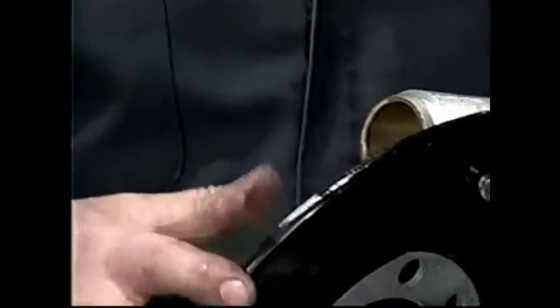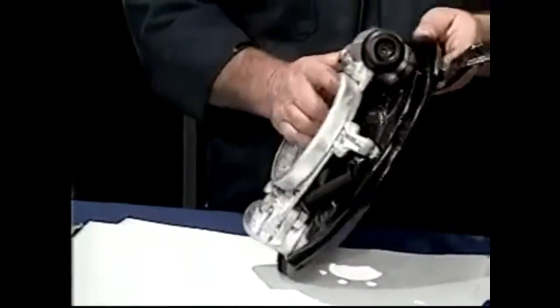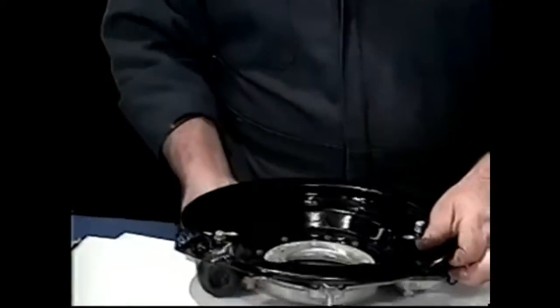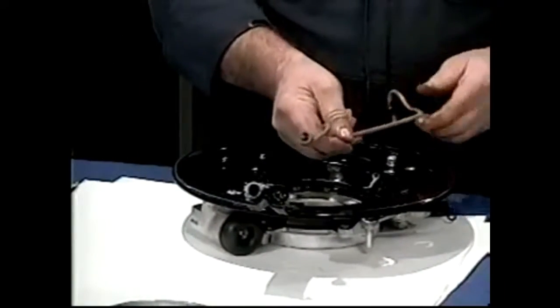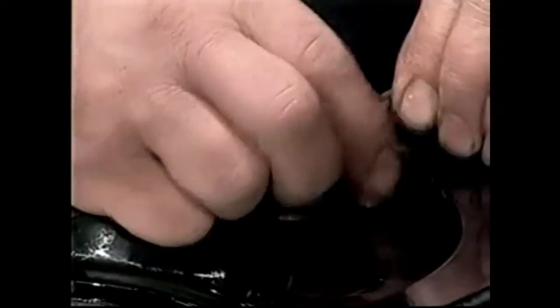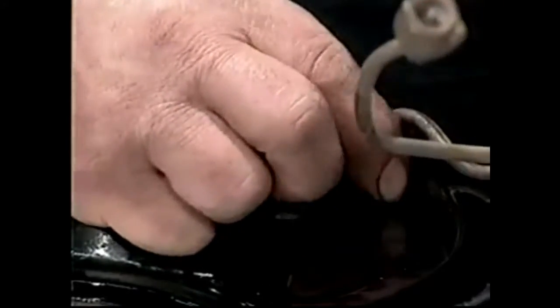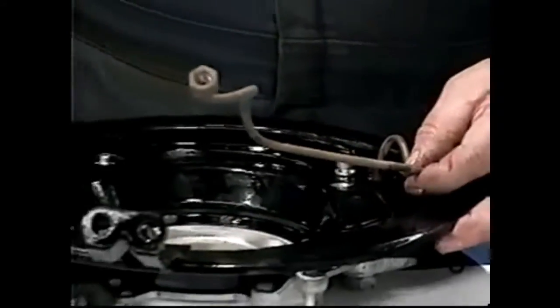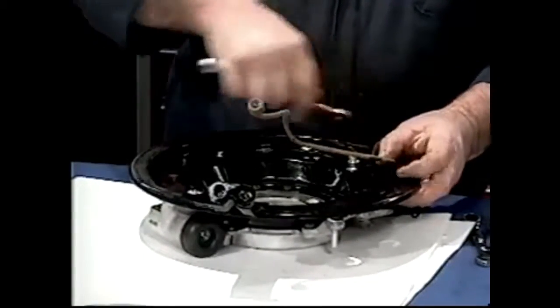Now we're going to do the other side, and that's the two wheel cylinders built. We're now going to go to the back and put the pipes on — remember we took the pipes out. Put that in. I'm going to have to bend the pipe down to show you. So I'm going to take it and nip it up, like so, and then ease it there. This is the point that we bent it at, so we're going to push it down.